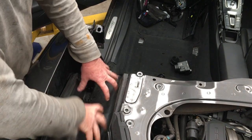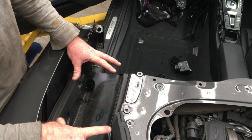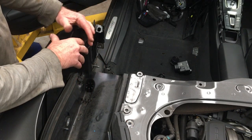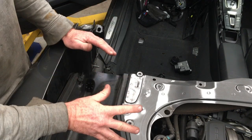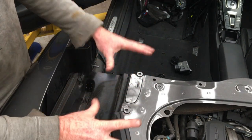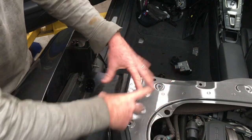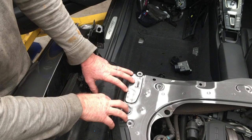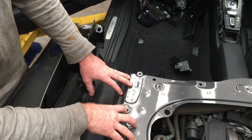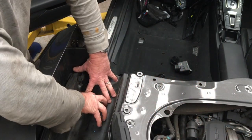For the rear bucket, how do I keep stuff from getting in there? Because there are only really small holes here, leaves and stuff getting down there would be really hard. I reckon a lot of it is from when people lower the roof and there's debris on the roof - everything gets folded up and eventually some of that ends up inside the bay. When I removed the roof of this car there was lots of gunk underneath it, just on that carpet that sits in the bottom of the convertible bay, and that's all designed to flow down into here.